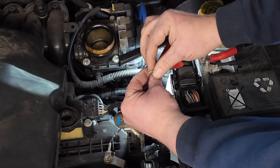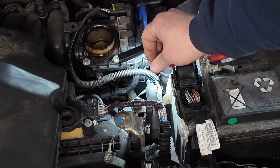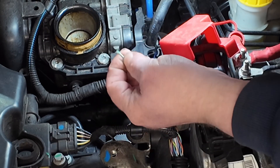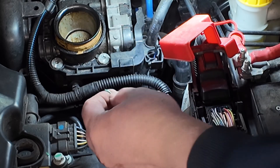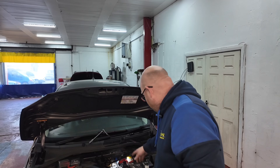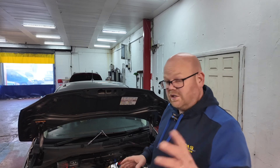And there we go - look at that. It's gone straight through. Let's zoom in on that. It's gone right through, right on that circuit there. So we knew we had a broken wire, and the voltage is still coming through. So now what we've got to do is strip that out a bit further, get to that wire, do a solder joint on there, and just double check it, make sure it's all okay. Let's get it repaired.